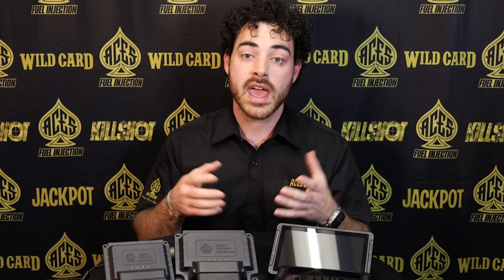One smart thing we always recommend is that you back up your tune to your laptop using the data cable and the ACES tuning software. Whenever you upgrade your handheld, sometimes there's also an ECU upgrade that comes with it, and that is going to wipe any of the learned data your system has accumulated, resetting it back to zero. So just export that tune using the data cable and tuning software, then reload it back into your system after completing the handheld and ECU update.